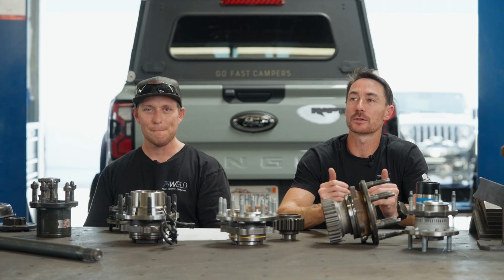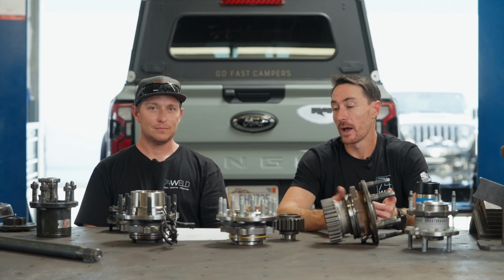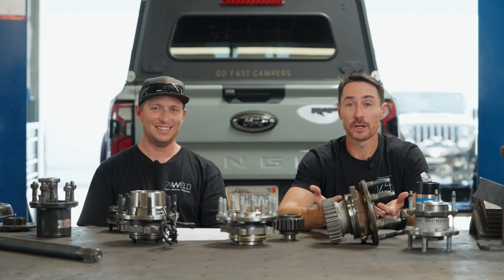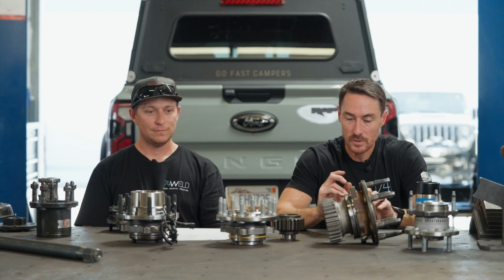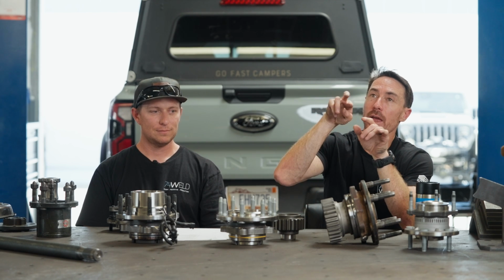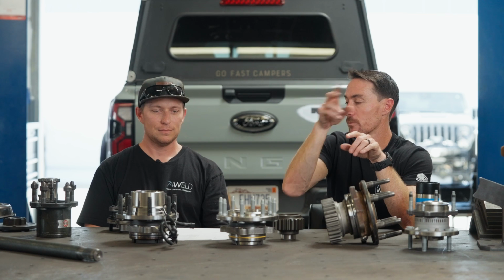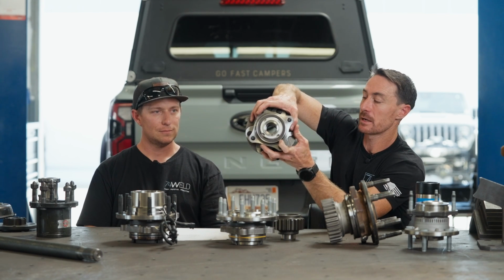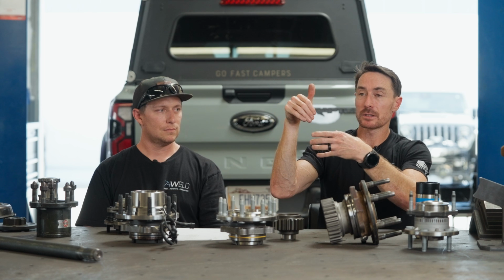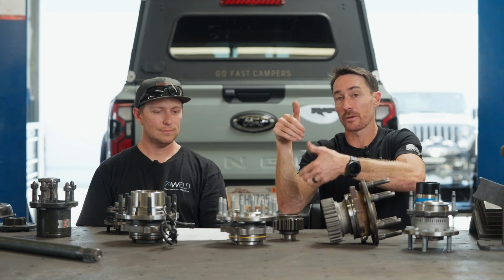So very exciting. I'll speak briefly on magnetic encoders. How do you know if your vehicle has a tone ring or a magnetic encoder? Do you have something called hill hold? If you get on a hill, does your vehicle roll backwards, or does it magically hold and not roll backwards? The way vehicle software manages this is they have a magnetic encoder, with oriented pairs of magnets, oriented north-south, and a certain number of pairs of magnets run around this black ring out here. Your wheel speed sensor picks up a signal, and because of the magnetic field that comes off of those and how they're oriented north-south, they can tell whether it's going forwards or backwards.